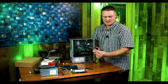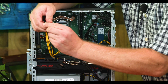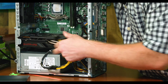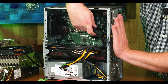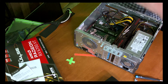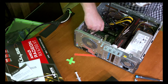We're going to take our 8-pin connector and we have a 6-pin to 8-pin adapter. Go ahead and snap the female-to-male adapter in. I'll have the two different kinds of these linked in the description below. We need to snap one apart so we have a 6-pin and an 8-pin — go ahead and plug the 8-pin in first. You may need right-angle adapters to allow us to close the case. We're going to throw the heatsink back in — there's already some thermal paste on there so I'm not cleaning it off. Make sure you plug your PWM 4-pin fan connector in first.